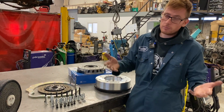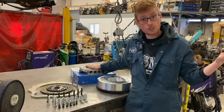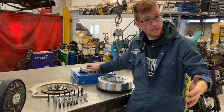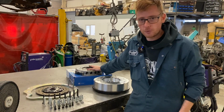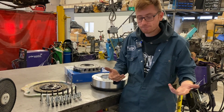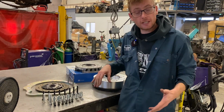On the obvious negative side, you're going to have a heavy pedal, but we do boosters, so you can have a vacuum operated booster that helps you with that, so you can have the best of both worlds if you want to. I run mine without a booster, and I'm not exactly Arnold Schwarzenegger. So anyway, that's pretty much the top and bottom of the kit.